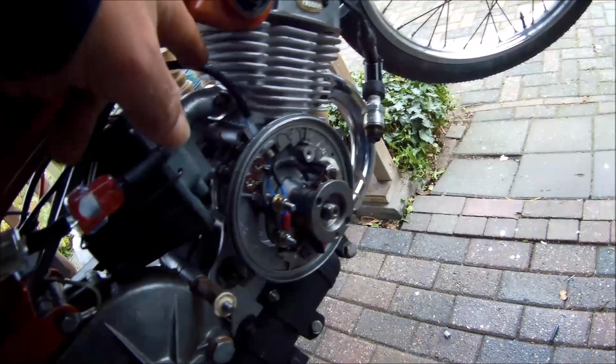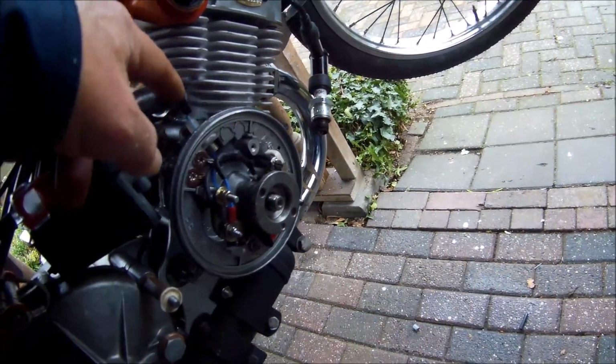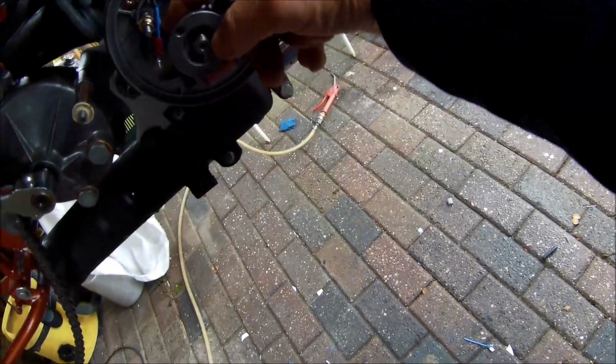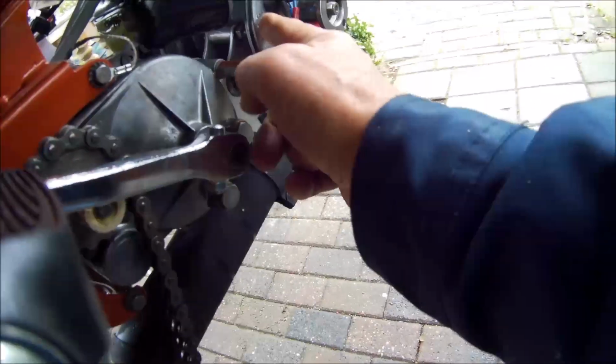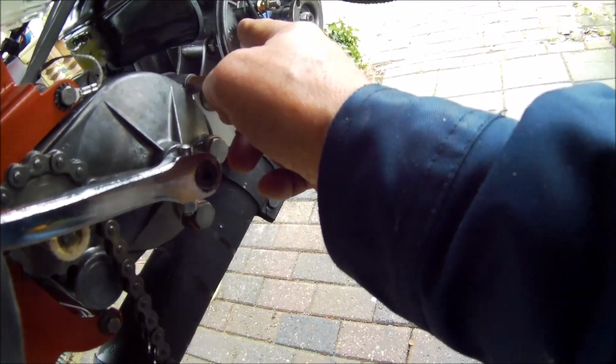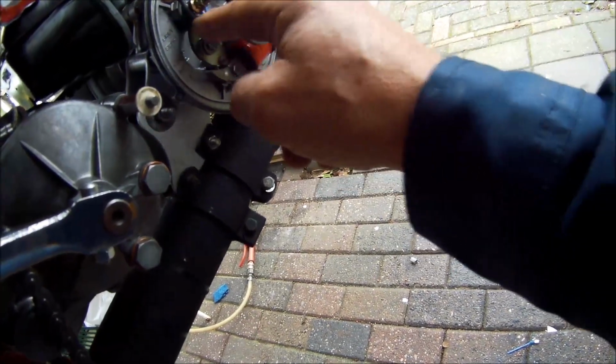Here comes the wire from the high tension coil. That blue wire is connected with this terminal. It's an isolated terminal, as it is mounted on a glass fiber reinforced piece of plastic, mounted with small screws in the spot where normally the condensator is mounted. So 2 small screws.